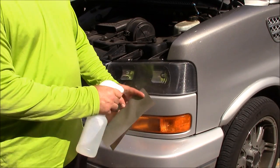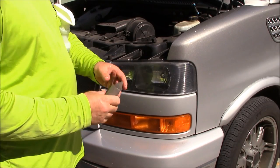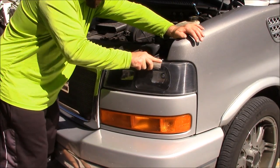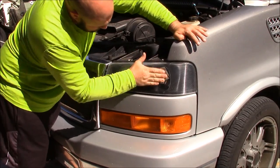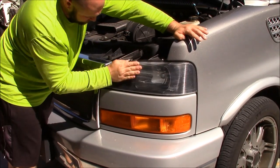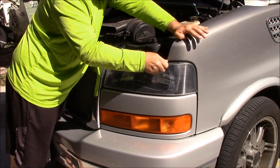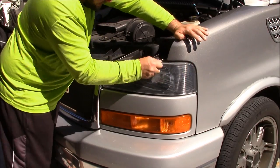A lot of guys will pre-soak their sandpaper in a bucket of water — I don't do any of that. It's a waste of time and I don't feel it does any better job. Lubricate the surface, lubricate the sandpaper, and then just go to town. You can absolutely use a polisher for this; you can absolutely tape it up — I would definitely recommend that. I'm going to be careful not to hit the paint, but I'm literally just rubbing this sandpaper into the surface.